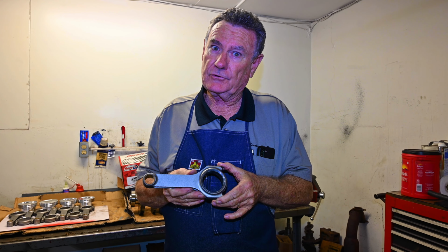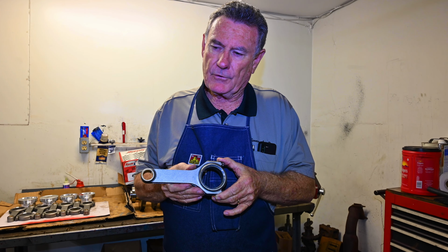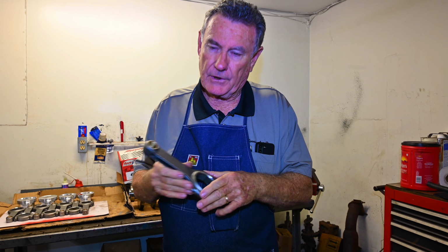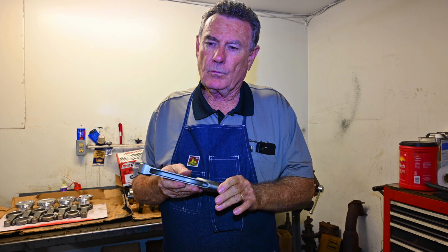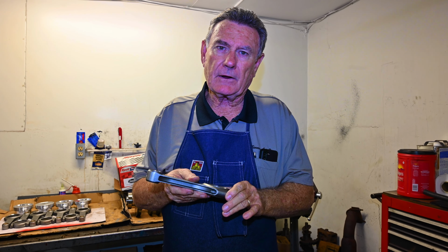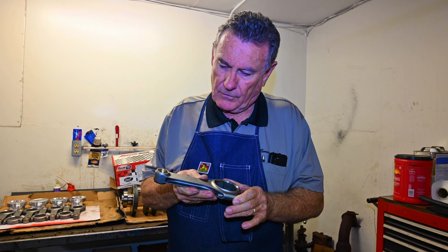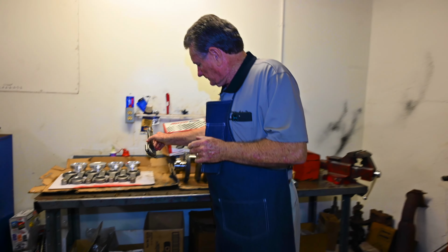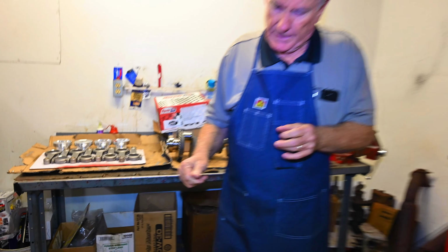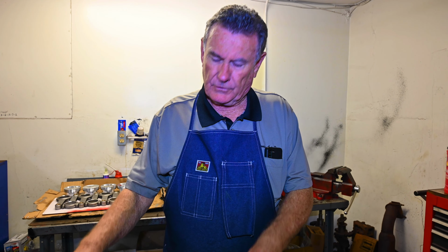They're actually very precision. The crankshafts are ground very precision, and the numbers that we're looking for on this particular build, we've got the numbers that we're looking for. So we're satisfied with our main bearing clearance number and our rod bearing clearance number. So we're going to start moving forward with this build. With that being said, the next stage will be putting the crankshaft in it, putting the camshaft in it.